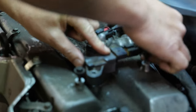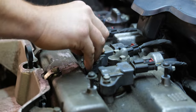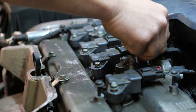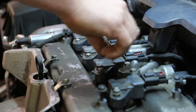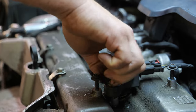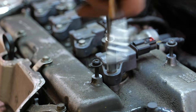We'll tell Danner he needs a valve cover gasket too. And then the other thing, he's got that little bit of a lean condition too that we don't like. And that's going to be, proceed how you guys feel fit based on the time you have involved in your initial diagnosis. Do we want to also smoke test this intake? If we have time, I think maybe we'll do that and include that in our initial diagnosis.